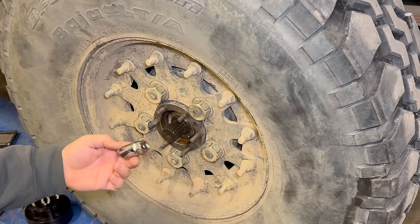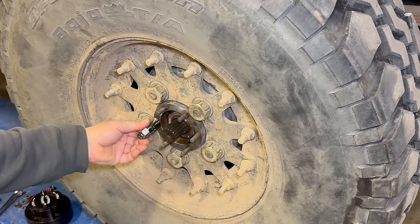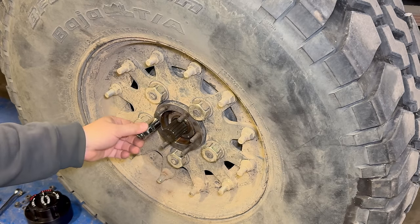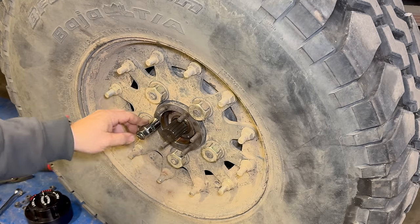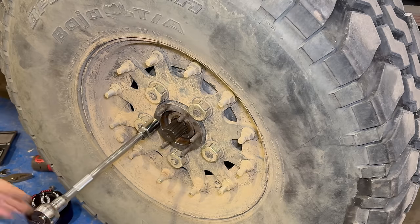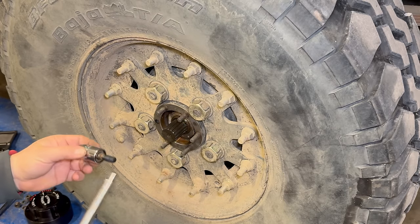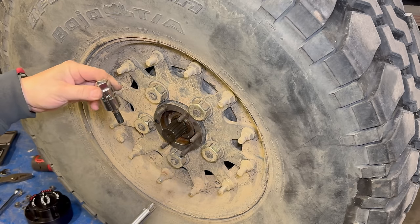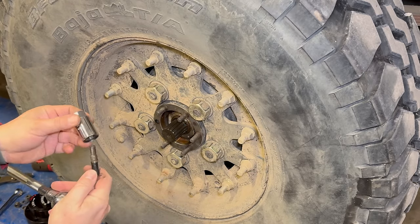I'll try to get this gasket off and get these studs removed. You've seen me use this stud remover before — you just stick it on your stud, turn it, and it will start to lock on. It works in either direction, so you can also use it to install studs. This one's coming out no problem. The hardest part about using one of these is getting the stud back out — either take some vice grips and turn it the other direction, or drop it on the ground. That loosened it up enough that just dropping it I was able to get it out.